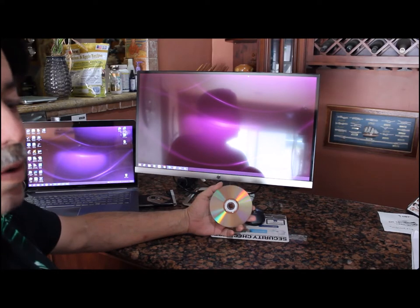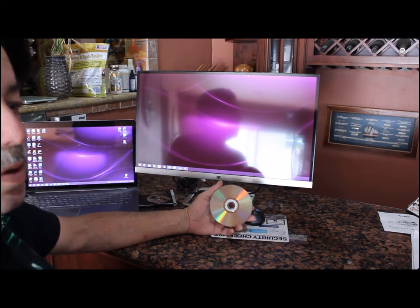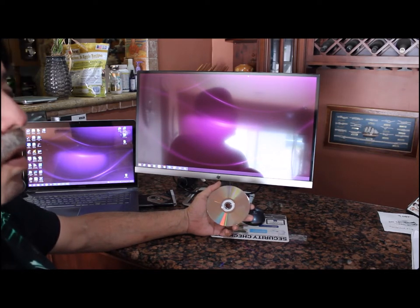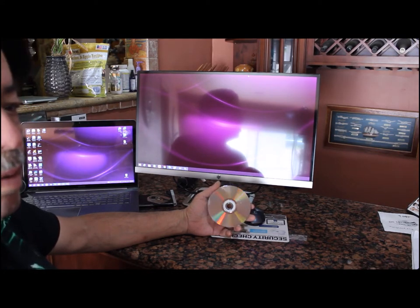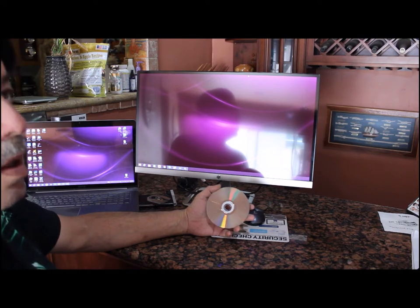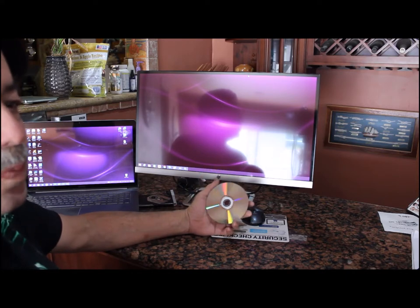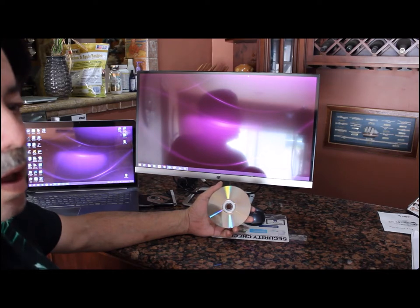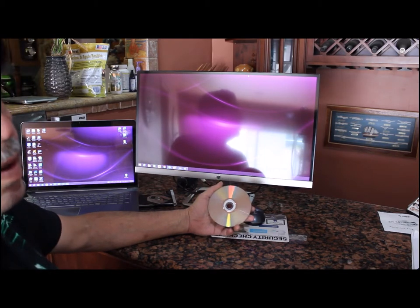I cleaned it and then I used 2500 grit wet dry sandpaper. Like I said, you can get it at Auto Supply or anywhere like that. I buffed it all over with that in circles, wiped it off. It looked real scratchy, real hazy. I went over it with rubbing compound. It's a step you see in a lot of videos that people don't do, but I used it anyway. It got out a lot of scratches, but it still left it real hazy and funky looking. Then I cleaned it and I used the Plastex, and I used that mandrel and that little buffing wheel that I had on there. And I just kept buffing it. I shortened the video, but it probably took me somewhere around 30 minutes.